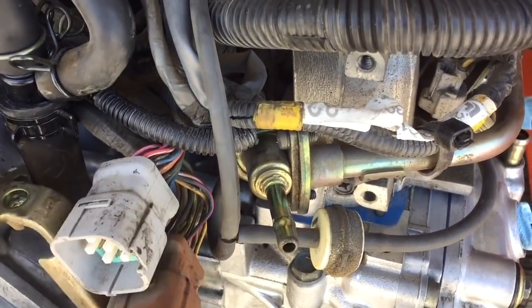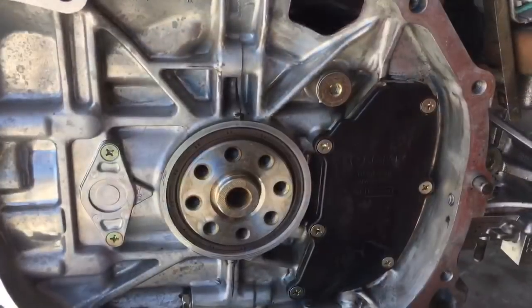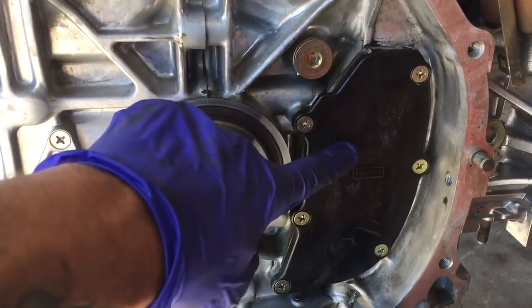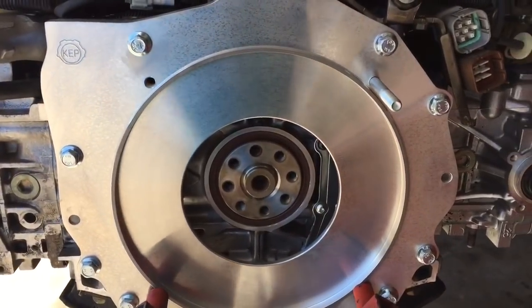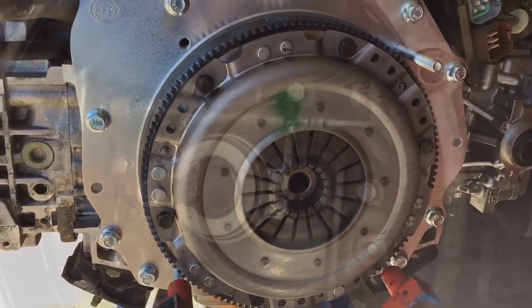Let's put up the backside of the engine. Remove the flex plate, now I'm going to replace the rear main seal and the plastic oil separator - those are in. Let's do the adapter now. The adapter's in. Let's get the clutch equipment on. Engine is good to go.